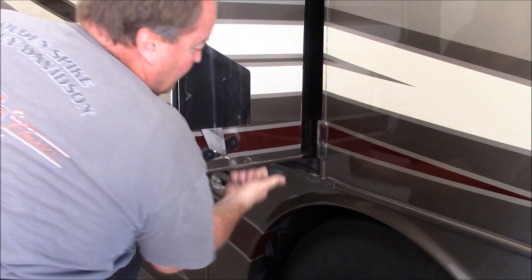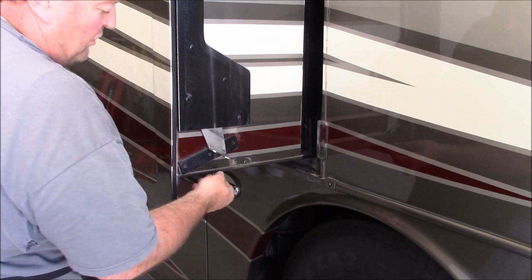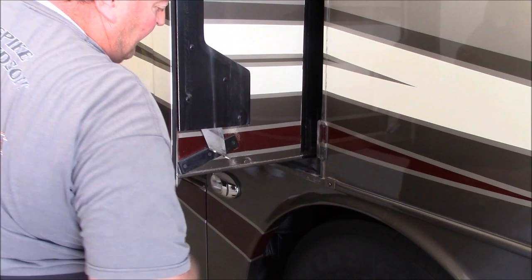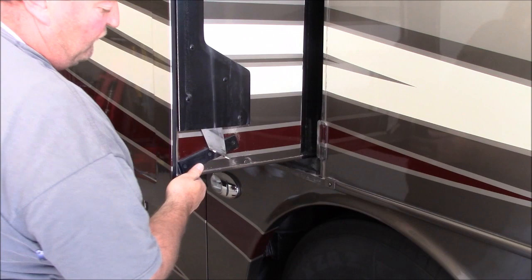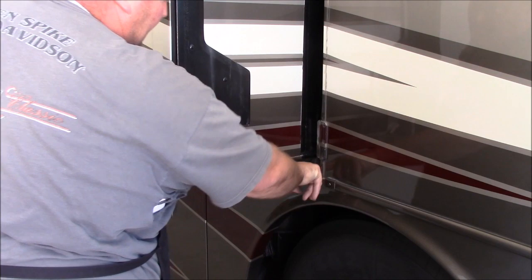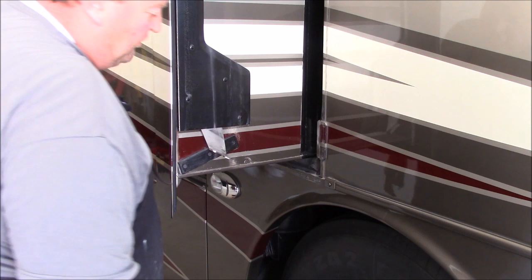If you have delamination, right before you get ready to glue it, you're going to want to pry down a little bit and squirt some of that 5200 up inside of there so that when you put that guardian plate on, it encapsulates it and evenly distributes that 5200 throughout, so when it cures, it bonds, and that will correct your floor rot issue if you have minor floor rot. Again, my floor is solid. I've been staying up on top of this sealant. I'm doing it solely as a precaution.